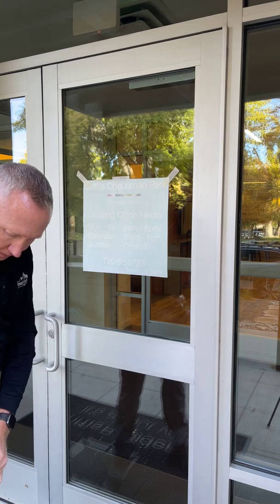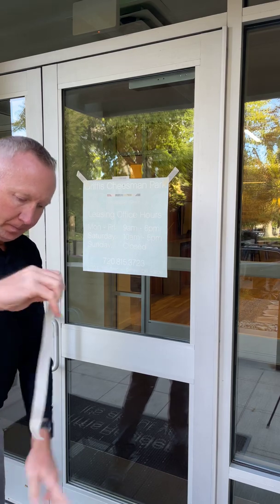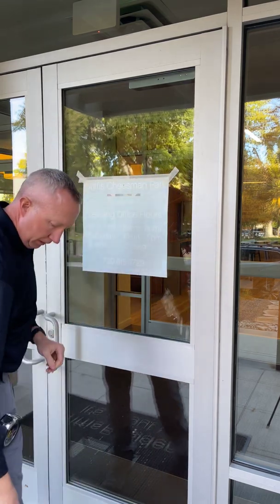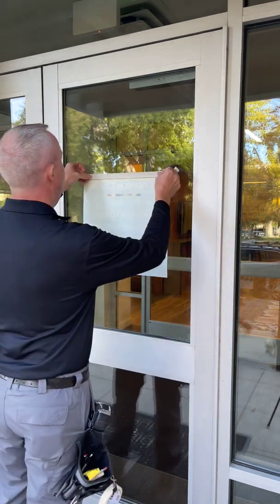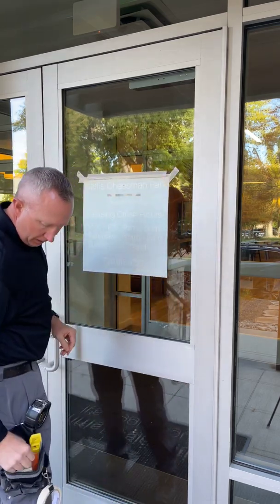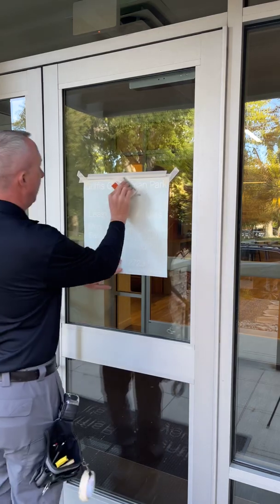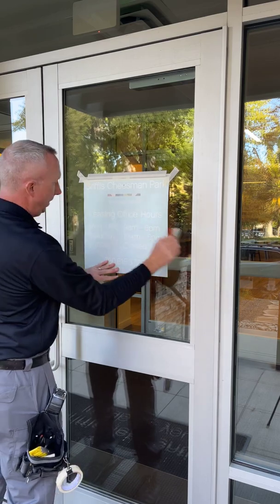And then at that point, I'm going to put a hinge of tape across the top of the graphic. And if it's a little bit cold outside, like it is today, sometimes I'll double the hinge as insurance on the top. So put that there. And the last step before we apply it, you use a credit card, driver's license, or if you happen to have a squeegee, use a squeegee. Just press the application tape onto the graphic one more time to make sure everything's fully adhered.